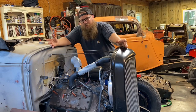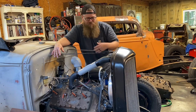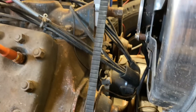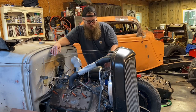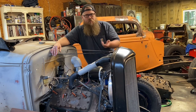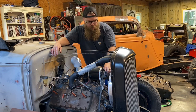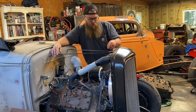Let's go over a couple of distributor options to help you diagnose your own car. I have a stock distributor cap for now. The ground side from the coil screws in right where the condenser is, and it goes down inside the distributor. To check your points, unscrew the ground side of the coil, have it where it's almost touching, and then with something insulated — I use a Snap-on screwdriver with a big rubber handle — open and close the points manually. You'll see an arc from the ground wire to the coil ground. That's how you check your points.